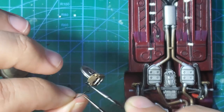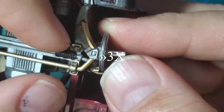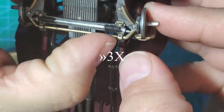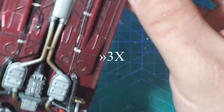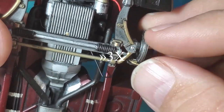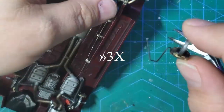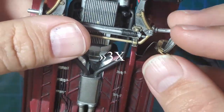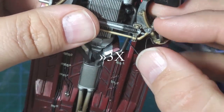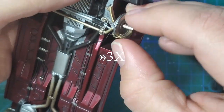I know I'm going to have potential clearance distance issues, so I'm going to immediately make a bend coming off that caliper, from a distance that I know will still clear the wheel. Then it becomes the process of test fitting, positioning, and shaping to get a somewhat realistic look. You just keep bending and test fitting until you find something you like. We're going to go ahead and just stub this into the engine bay.